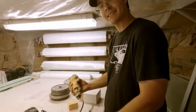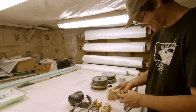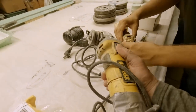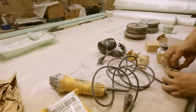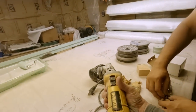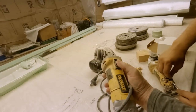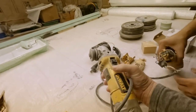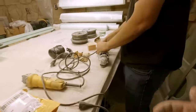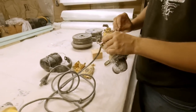What were the symptoms? The symptoms were it sporadically turning on and off when you were using it. These have just a thumb switch but it can lock, so I usually just lock them and run them because that's the most comfortable thing to do. That's why I like these ones as opposed to the paddle ones which are very fatiguing. But what happens is the brushes get worn - you'll turn it on and nothing will happen, give it a bump and it'll turn on.